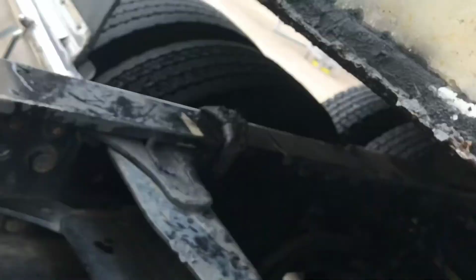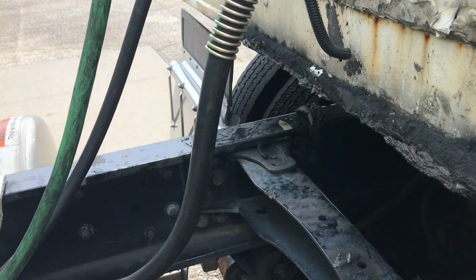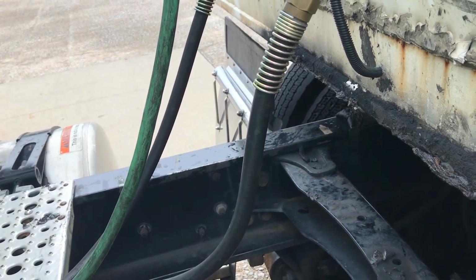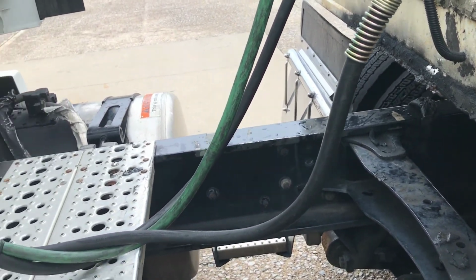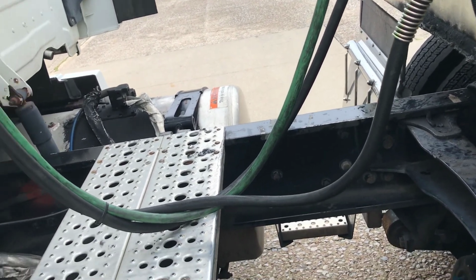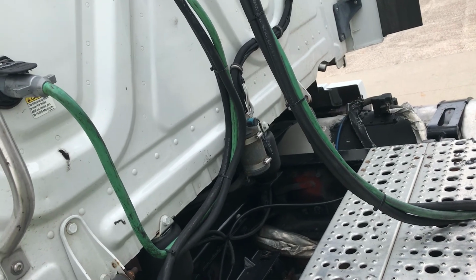These two are both the air hoses. The green one is electrical line. Air hoses, no cuts, bulges, or abrasions. Hose and coupling, not leaking air and are secure at both ends. Electrical lines are not cut or spliced. The lines are not tangled, pinched, or dragging against tractor parts.